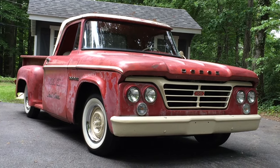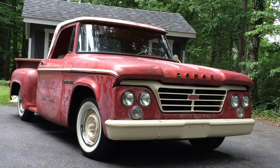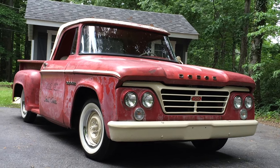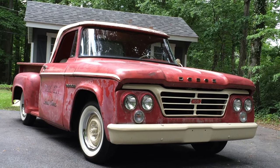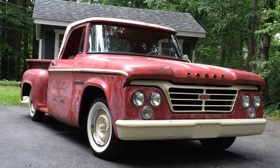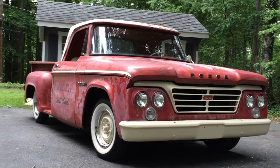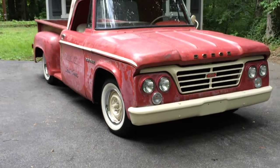I picked this thing up about a year ago out of northern New Jersey. It wasn't running right, it wasn't looking right — the stance was wrong, a lot of things weren't put together properly. I got it running and driving nicely, yanked off the old wheels and tires — there were snow tires on the back. It was a full six inches higher than it is today. I lowered the rear, did an axle swap, cut the perches off, shortened the axle, and pulled out some of the leaf springs in the front to balance out the ride.